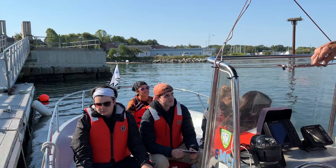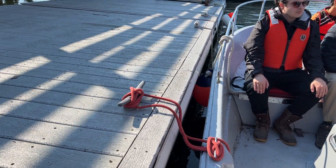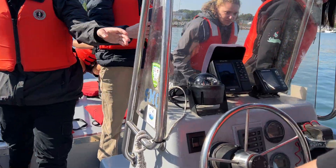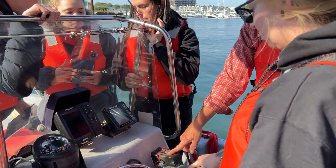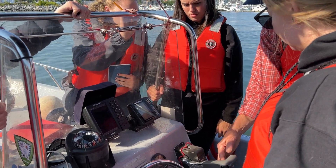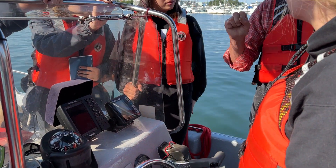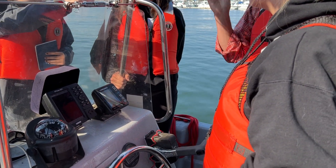The other thing we're going to do is, while we're tied up, we're going to go into reverse just to make sure it shifts when you're going forward. We're going to stand up and see if you can see this controller right here. This is a commercial control. Most pleasure boats have a little switch under here — you have to squeeze it in order to shift. That's a safety. This has no safety. If Kat wanted to, she could go from full forward to full reverse and just ruin my lower unit and throw all of us off the boat.